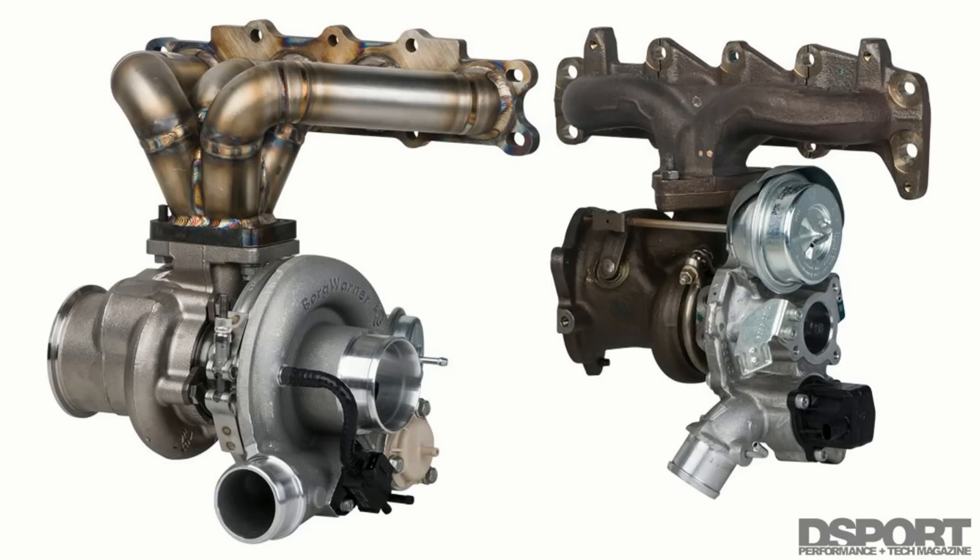This isn't a problem with a tiny turbocharger, but with a relatively large turbocharger it means your turbo has to spool all the way back up and make all that power again. This can be really frustrating on a racetrack, a canyon road, or an autocross course where throttle modulation is necessary.